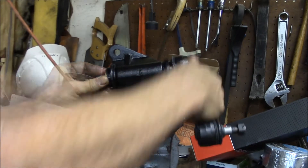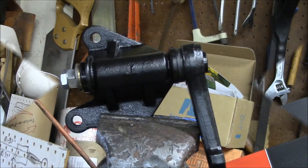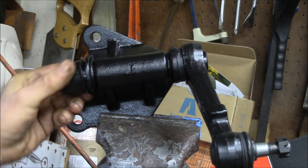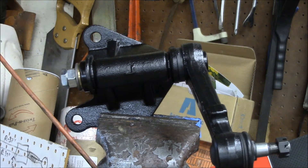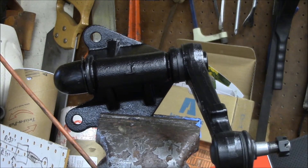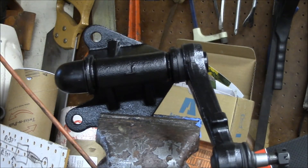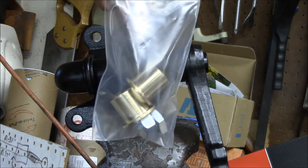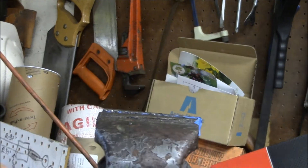We've got bronze bushings in both sides, shove the shaft all the way through, put the washer and nuts on the end, and put the cap back on — and this one is ready to go out to a customer. We just put the cap on lightly because the customer still has to torque it down once it's installed on their truck. After you cycle it a few times — run the steering lock to lock to get everything seated — then torque it down. You can also buy the arm from us or any auto parts store and buy the bushings separately to install yourself.